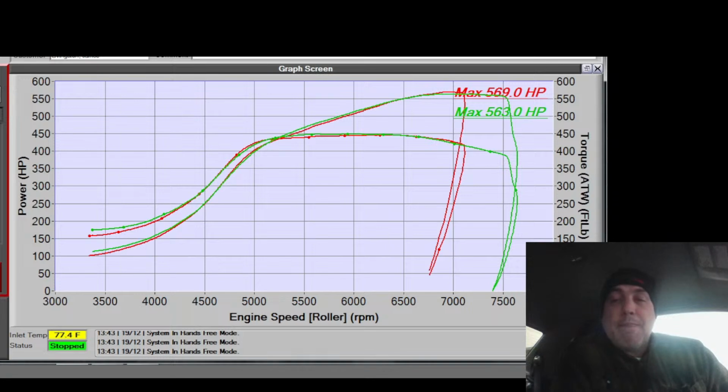Correct. Yep, that's correct, Mark. In the summer, the air density is a lot less. It takes a lot more RPM to move the same mass of air. Right? Think about it. If the air is colder, and I take my hand, I move it like this through cold air, or move it through warm air, which one's going to affect more air molecules?